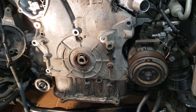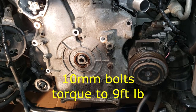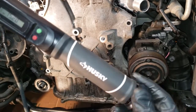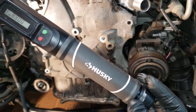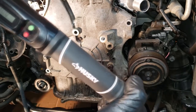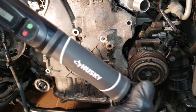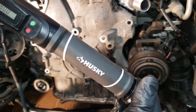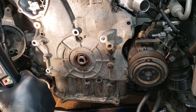Now the little ones — the 10 millimeter — those are going to be 9 foot pounds. I gotta go ahead and turn this torque wrench down. I think it'll go to 9. Close enough — 9 foot pounds. Now we're going to do all the little ones. It's supposed to be done in a sequence, but I'm just going to do it as I please.